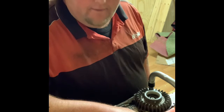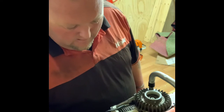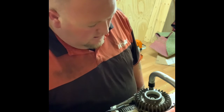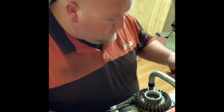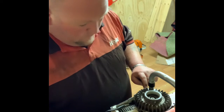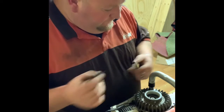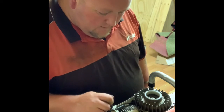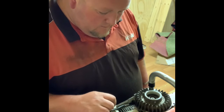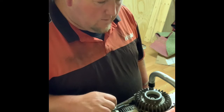So yeah, just caught this helicoil on this. Come halfway out. This one here's all the way in. This one's two threads in. This one's flush. It just needs new screws. So they're not really a tight fit. No, wrong size.